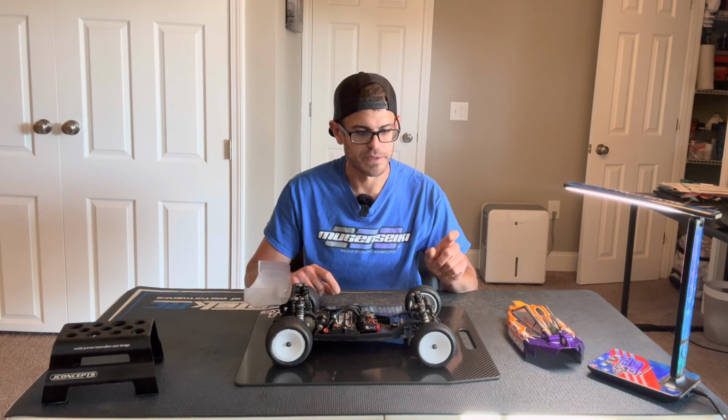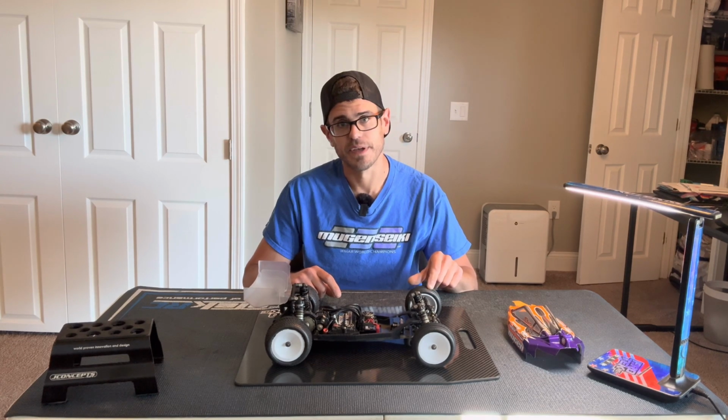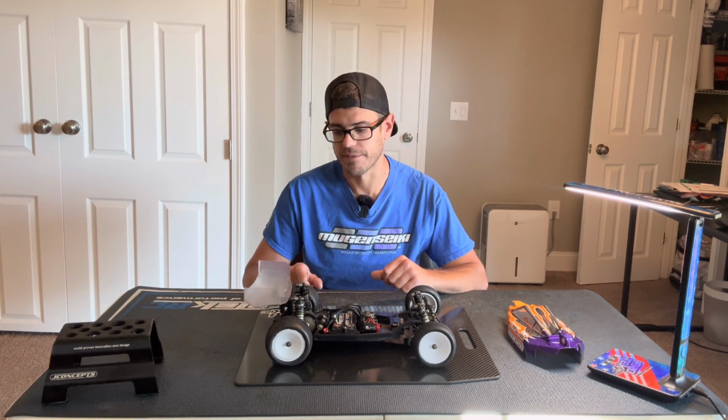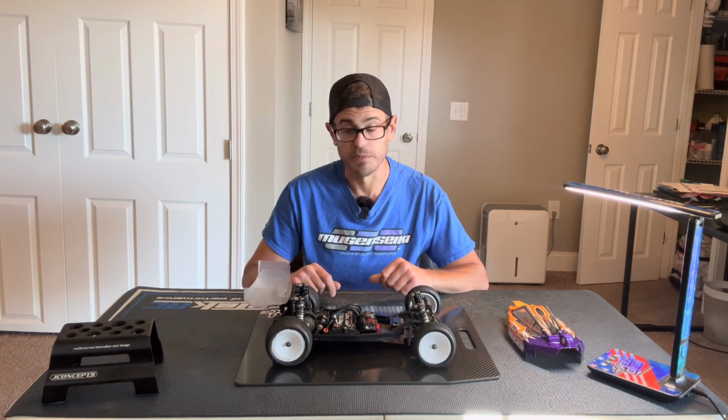They're usually the 2mm thick, 2-hole by 1.7mm diameter holes in the front, and in the rear 2-hole that are 1.8mm each, plus a 1.0mm third hole, and 2mm thick pistons in the rear. I think that's a good baseline.